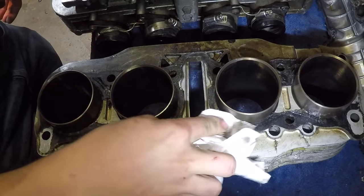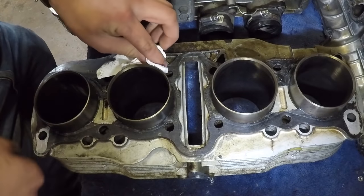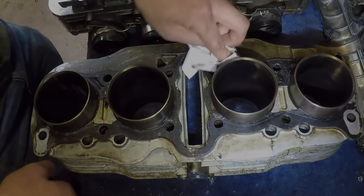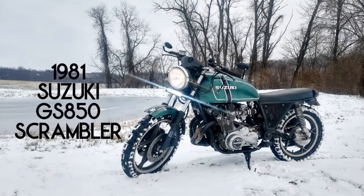It's been about half an hour and the aircraft remover did basically nothing - it might have softened the gasket paper up just a little bit, but it really didn't help too much. I decided to stop the video there. After some research I found out that a lot of people like these 3M roll lock bristle discs for removing gaskets. I bought one with Amazon Prime and it should get here in a couple days. In those couple days I'll finish up this gasket replacement, get the engine back together, and hopefully get this bike on the road. Thank you guys for watching - please subscribe, like the video, comment down below, and I'll see you guys next time.